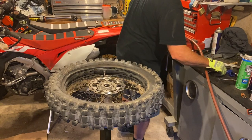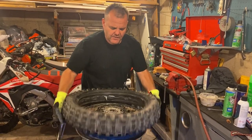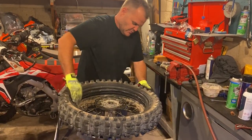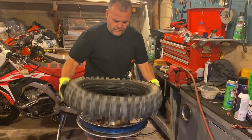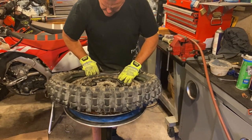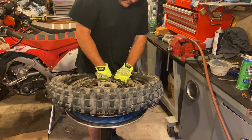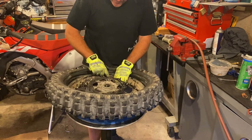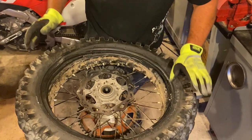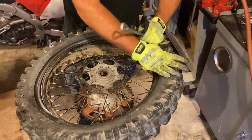I'm going to grab a nut, which I keep in my mouth — you don't want to share that with anyone else. I have tire paste here — we used tire paste from Hunter Engineering, really good stuff. I wish somebody in the moto industry had something as good and they would sponsor me. While putting a used tire on I'm always looking for that good edge, making sure it's going the right way. I put the nut on and I'm just about halfway on the stem, pushing and making sure the tube is inside the tire. On KTMs the rim lock and valve stem are really close together, which makes it a little easier.